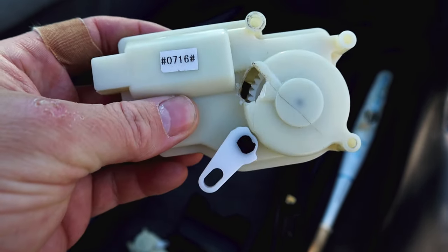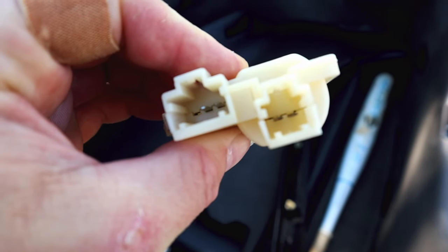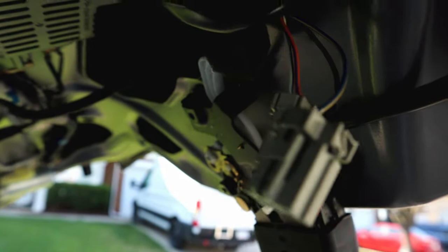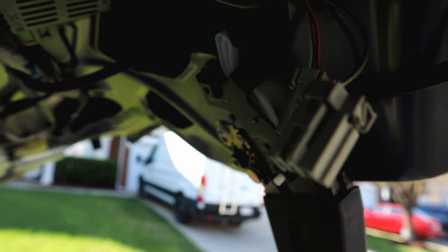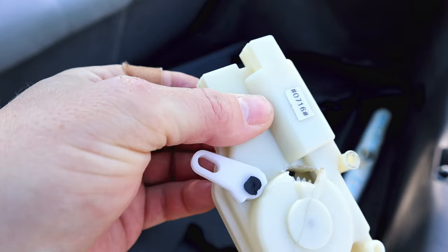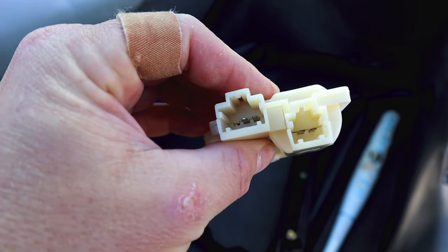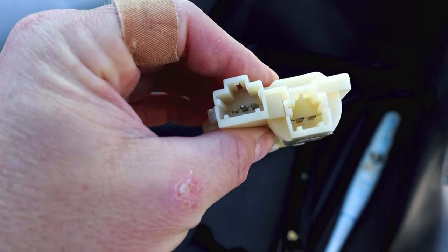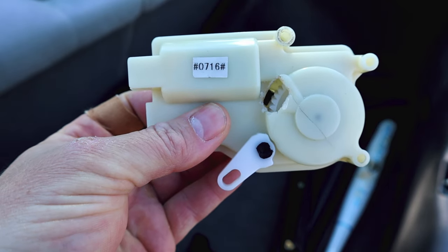There's a little backstory on this car. When it first came to me, there were problems with the trunk controls — the electronic controls wouldn't work to unlock and lock the trunk. I took apart the panels on the hatch and noticed one of the tabs was broken off on the plug, and the plug had actually separated from the actuator, probably through vibration. I just plugged it back in, put everything back together, and it worked fine for about a year and a half. But now we have a different symptom.